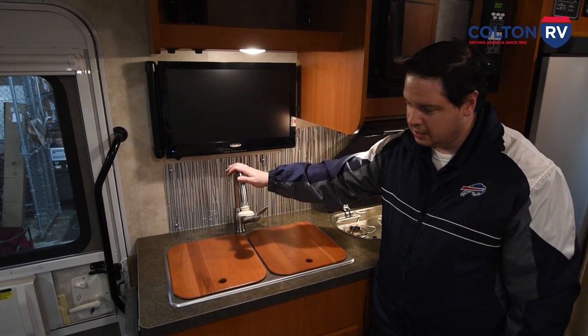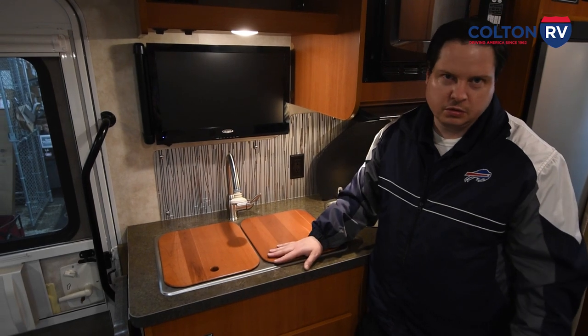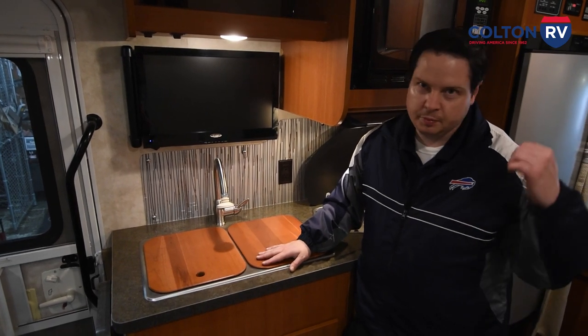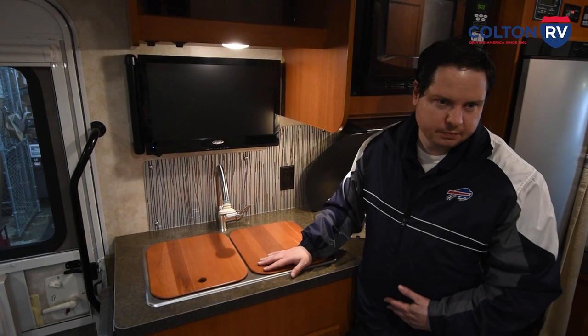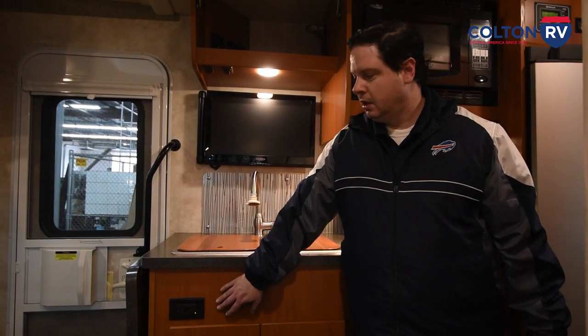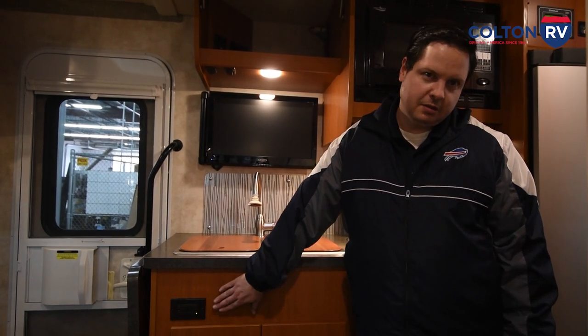Right below your TV is your kitchen sink — it's identical to your home sink. If you've got a water hose hooked up at a campsite with a spigot turned on, you just operate it just like your house faucet. Down below the sink is your GFI outlet. Just like a house bathroom, they have outlets that if they get wet, they trip and turn off. If you find an outlet in this RV that's not working, check this area — there's your test and reset button on it, just like a bathroom outlet. If your outlet does not have power, it's a good idea to check here and make sure the button hasn't tripped.